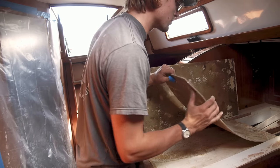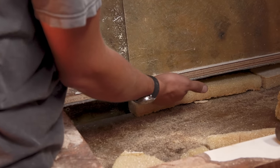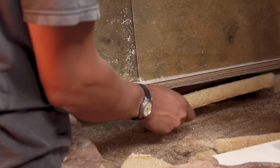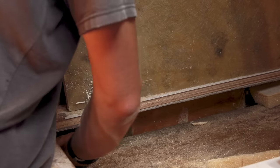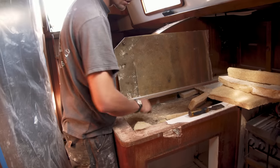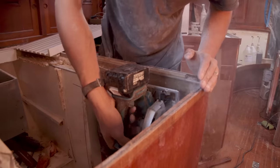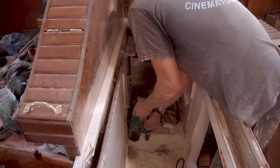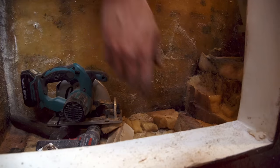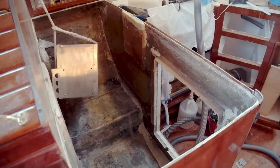There's not a whole lot of foam in here. The foam was sitting like this, so there was already a gap — only about an inch and a half of foam just floating around, and on the back side between the liner and the actual wall there is no foam. Re-insulating our fridge has been on our to-do list since the very beginning, when we first noticed that our fridge compressor was constantly running and fresh produce wasn't lasting as long as it should.